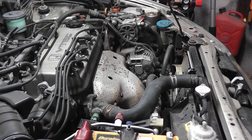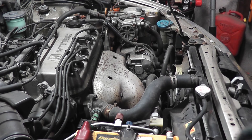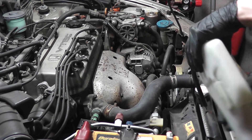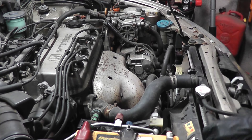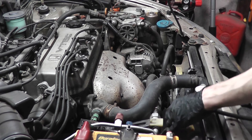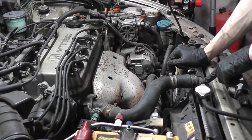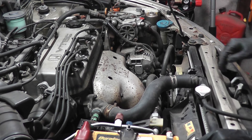Here's where it gets a bit messy because this hose is blocking the radiator fan. I want to get the hose out towards the front of the vehicle so it's not in my way. I'll pull the hose off and pull the fan out, then reverse that process when I put the new fan in. And the reason I'm not opening the petcock at the bottom of the radiator is that especially with old radiators, they may break — so I try to avoid using those whenever possible.